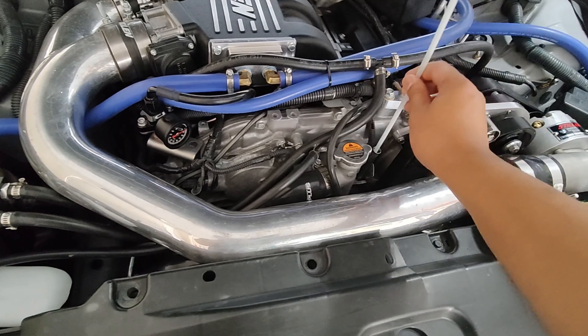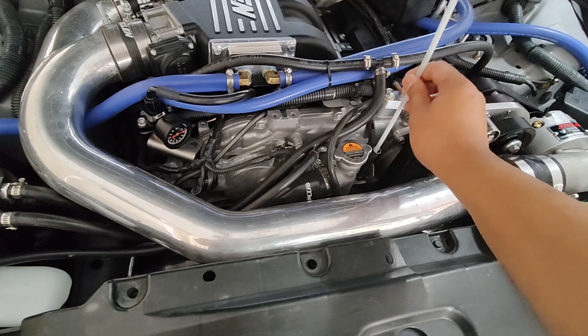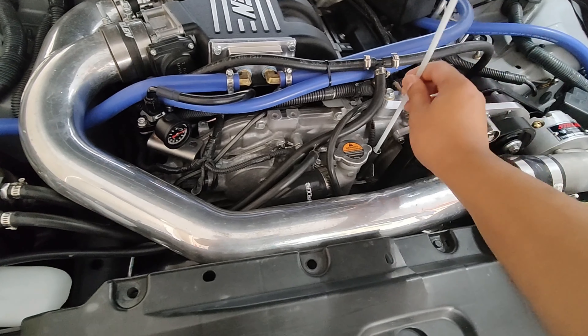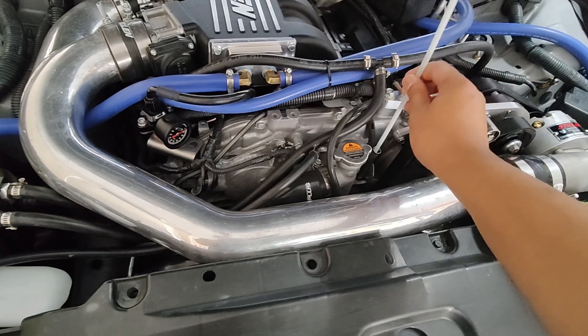I got confused because this right here is for a compressor, and I was pumping with it open. So when you pump — you can hear it getting oil right there — but you got to close that. This is closed right now but if you open it, it's not going to have the suction to create that siphon. So this is what I was doing — I had this open for the compressor, so when I was pumping it would come out but it wouldn't create that suction for the siphon to get the oil into the canister.